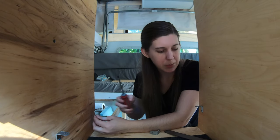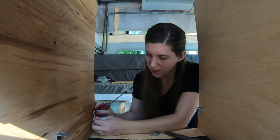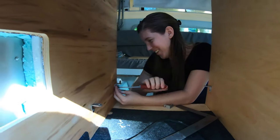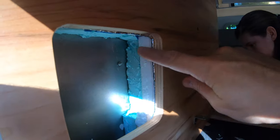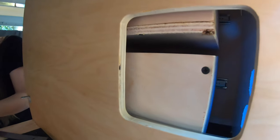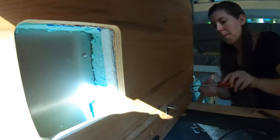So, this is going to be the floor of the fridge stand thing. Dometic fridge will sit on top of here. So here's a better look at the venting on the fridge space. Each side of the fridge will have a space where the compressor can pull air to cool down. That one goes back behind the drawers. This one goes over to the propane cabinet and down. Should be good.